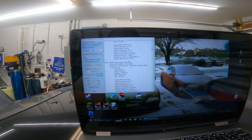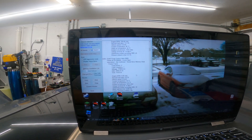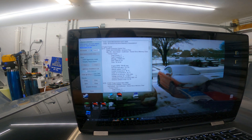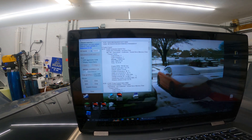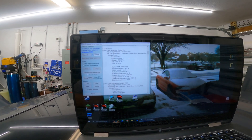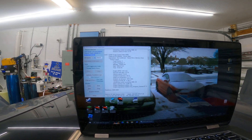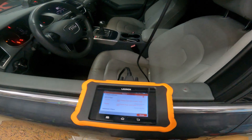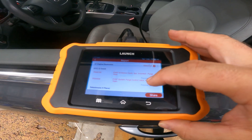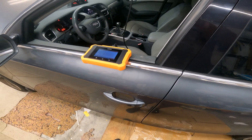The circuit open was because it was unplugged at one point for the control valve N80. That one is fixed since it's plugged back in, but the P0441 is not. Look at all that extra information you get with VCDS that you don't get with the Launch system — other than that, both came up with pretty much identical information.